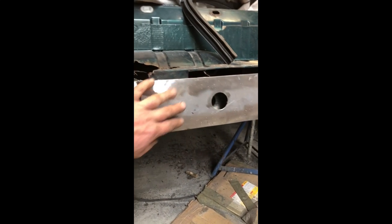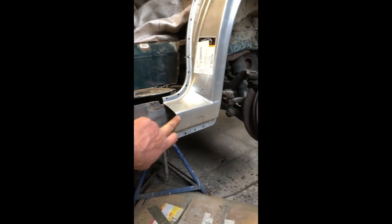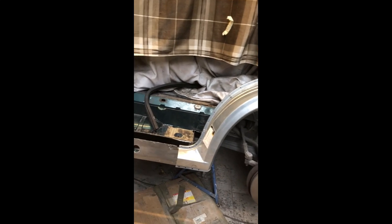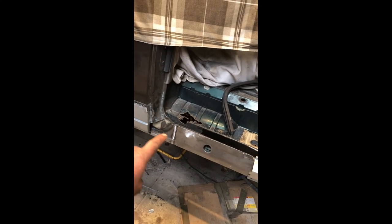This intermediate plate in the middle of the sill panel, so you've got an inner, a middle and an outer. The insides of all the jacking point, the back of the jacking point and the front. Didn't cut the whole thing out because it was still structurally sound and just to save a bit of time. And now I've just screwed the fender on. And I'm just about to put the door on and check for alignment, and then I'll put the outer sill